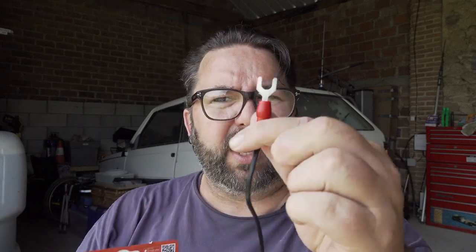BM2, built-in protection. And it says it's got a 1.5 milliamp draw. So if you're going to leave your car parked up for a long, long time without a charger on it, I don't know how long it would take to flatten your battery. But we're going to plug it on and see how it goes. I'm hopefully not going to disconnect the battery — I'll just slacken the terminals enough to get those on. So I'll get it fitted and then I'll be back with you.